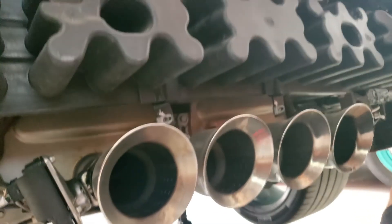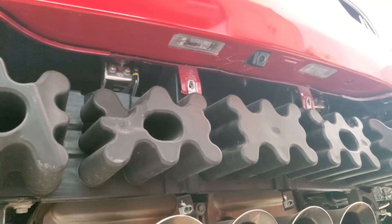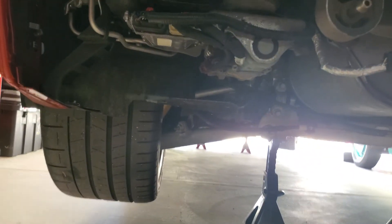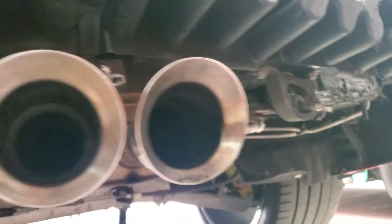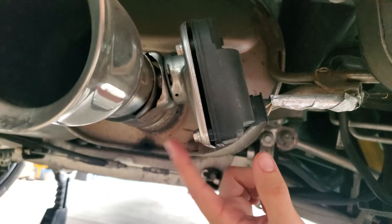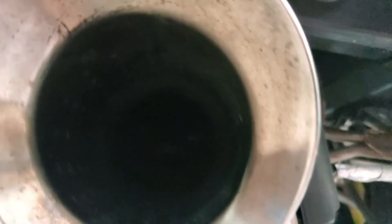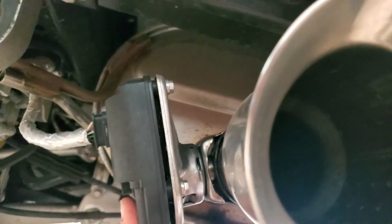The bumper's out — it was actually pretty easy. There are a few screws there, two on that side, two more on the other side, and a bunch down below. Other than that, it just came off. I honestly thought it was going to be a lot harder. Now you can see the actuator. There's nothing wrong with this one — it works perfectly. There's the valve, it's open right now. The actuator on the other side is also fine; the problem is the one on the other side that we still can't see from here — it's somewhere down there. We still have to take this whole thing out.